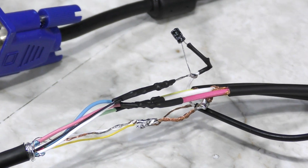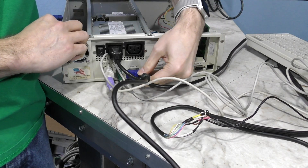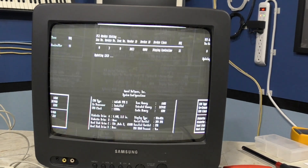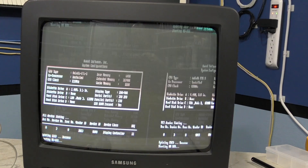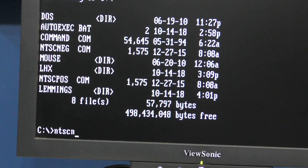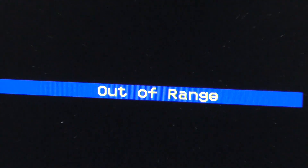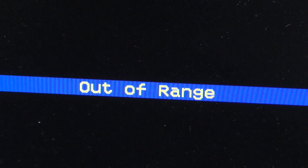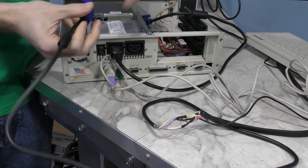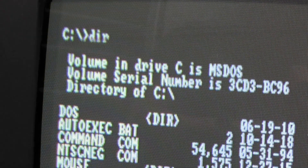This is just a quick and dirty way to make this cable in the interest of a demonstration — obviously it could use a lot of improvement. If you plug this into the TV and power on the computer, you're going to see this. There's obviously a video signal here but it's at the wrong frequency for the TV. There's this little DOS program that will change the output frequency of the VGA card. Of course when I do this on my VGA monitor it loses picture and says out of range, because the VGA monitor was not designed to work at NTSC frequencies. So let's swap the VGA cable back over to the TV — and yep, there it is. VGA text mode is displayed on the TV and it's actually pretty clear, not as clear as a VGA monitor, but most certainly readable.